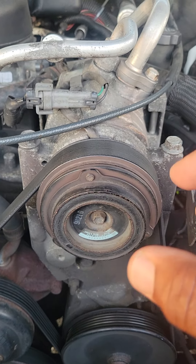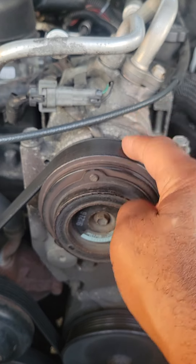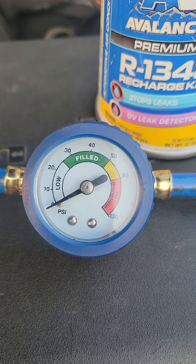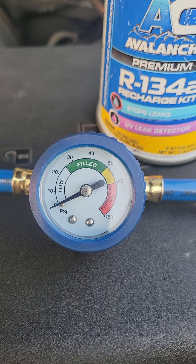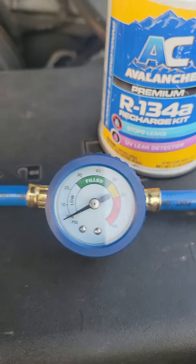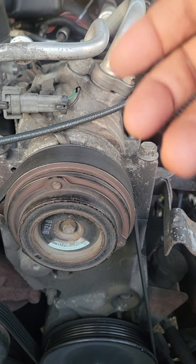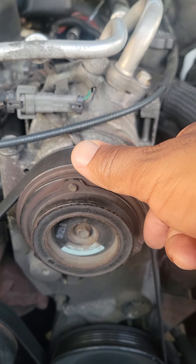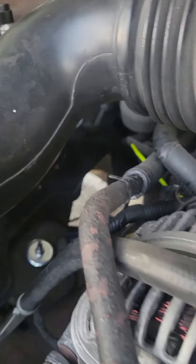Now, let's say the wheel is spinning — if it spins, start with a half can. Again, your goal is to bring the system up to about 40 PSI, then go into the vehicle and check if that has made the air conditioning system colder. If it has, watch the system over a couple of days because more than likely you have a leak. If it's still blowing warm air, run your system for a couple of days anyway, giving the Freon and dye a chance to move throughout your entire air conditioning system.